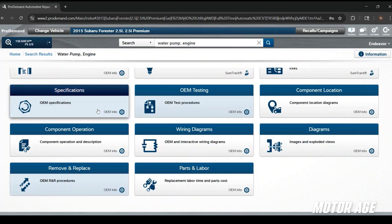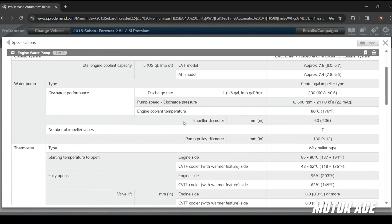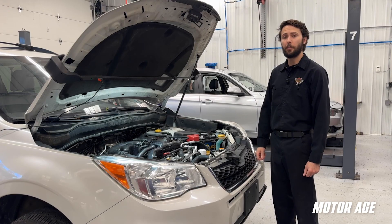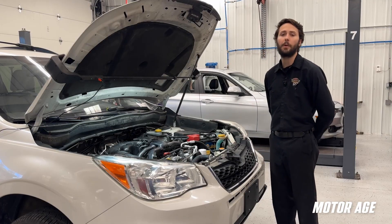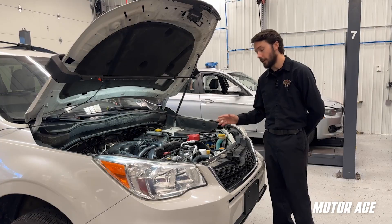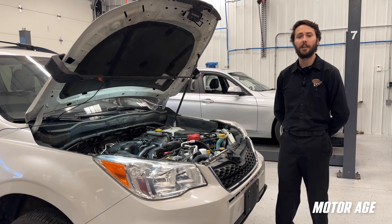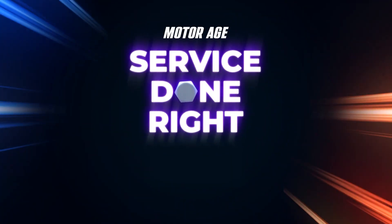While bringing the engine up to temperature, I put a scan tool in the vehicle to monitor engine coolant temperature sensor data and compare it to the known good values listed in Mitchell's OE specifications tab — things like engine coolant temperature during normal operation and thermostat opening values. Using an infrared temperature gun, I watched the temperature of both the upper and lower radiator hoses to make sure the thermostat was opening at the correct time. The coolant bleed procedure is nearly complete. I've done a preliminary leak check and everything looks good, so we're almost ready for our final test drive. Thanks to Mitchell One for sponsoring today's video — we'll see you next time.